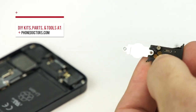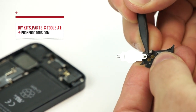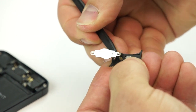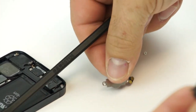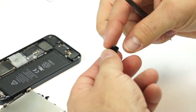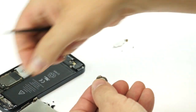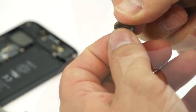We're going to take this all apart with a Phillips screwdriver — this is for your home button. We've got one screw here and two screws there. Be real careful because the home button cable is adhered by 3M adhesive to the plastic frame. We include black plastic tools — really high quality — to come behind the cable and just slowly peel it up. You do not want to rip this cable or you'll be without a home button. Just nice and easy peel that up. The home button has some broken shards of glass on there, so carefully detach and clean it off.